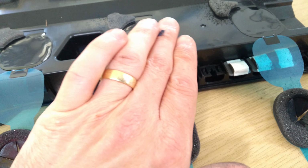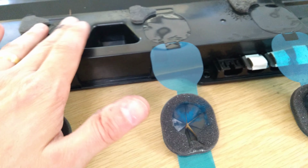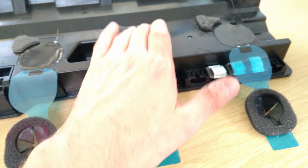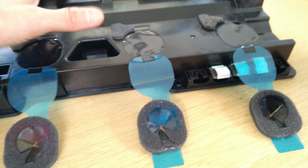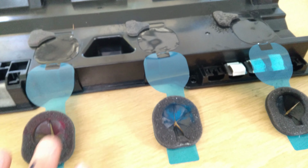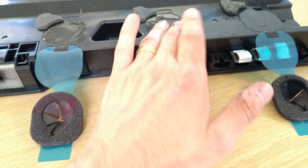My hands were dirty from lots of dust anyway, but I do have some toner on my hands and on the back of my fingers. When washing toner off of your fingers, do not use hot water, because hot water or heat inside the printer is what fuses toner to the page. Use cold water, plenty of it, hopefully wash it off. However, Google for more advice on that.